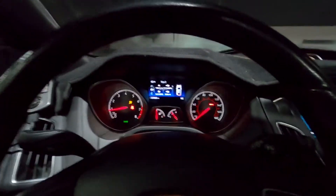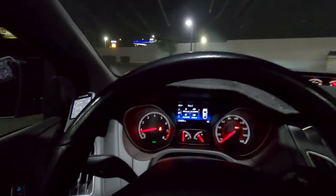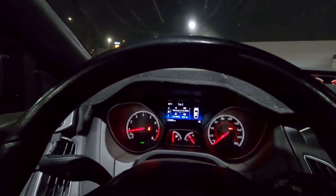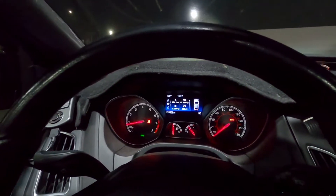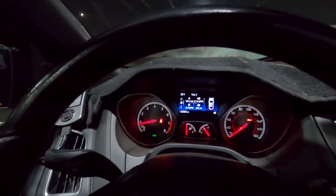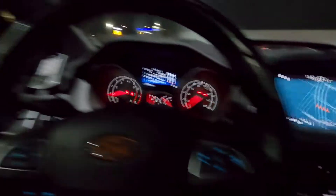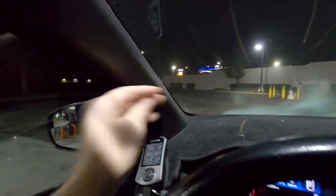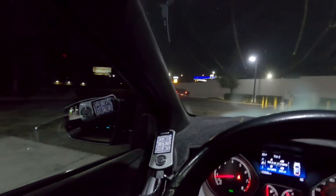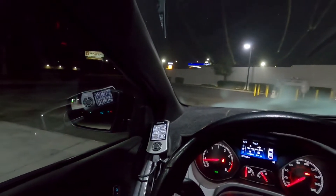Started the car back up. An important thing when you refuel running E30 or E50: I usually let the car idle for about 30 seconds, then start driving and stay out of boost for three to five miles or five to ten minutes — whichever comes first — just to let the fuel mix fully. You don't want to get into boost if it's not fully mixed yet. I don't have an ethanol sensor, but I really want one — it mounts up here and shows you the ethanol content of your fuel tank. They're a few hundred bucks and apparently not bad to install.